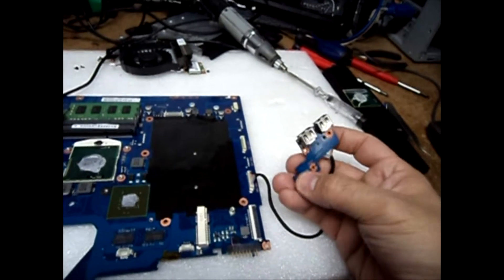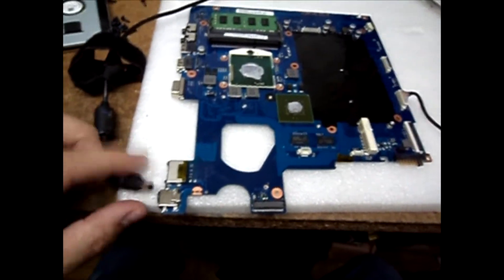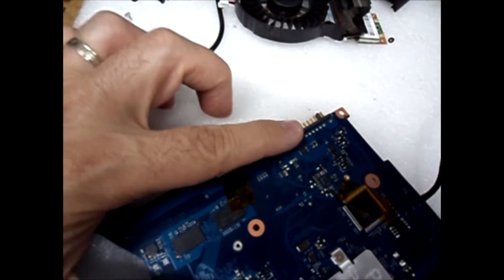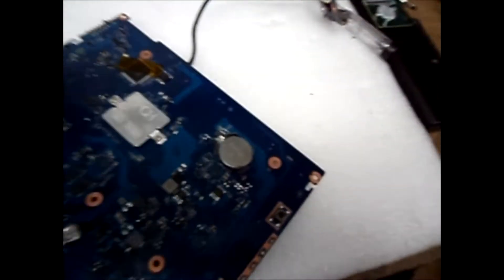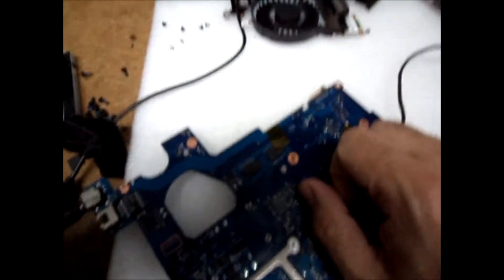So you connect it and try to power it on and nothing happens. I've tested it — it's got the 19V rail on the power supply, all the way until these little MOSFETs right here by the battery connector. So the power button is 0V, there's nothing there. I've traced it over here, so let's change these little guys and see what happens.